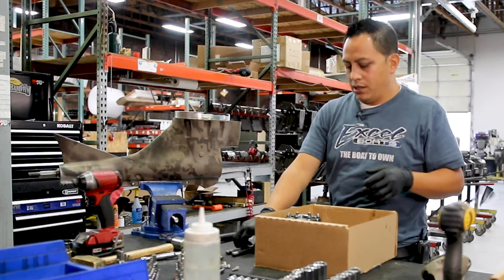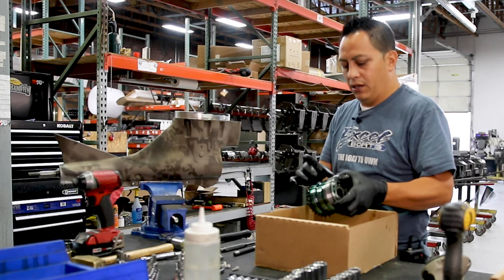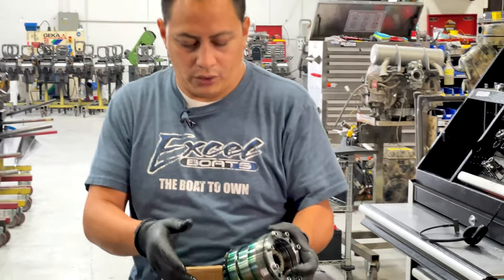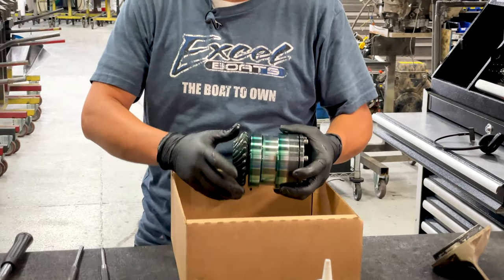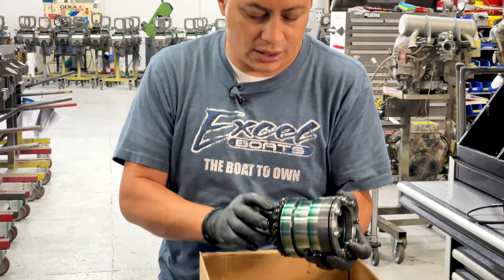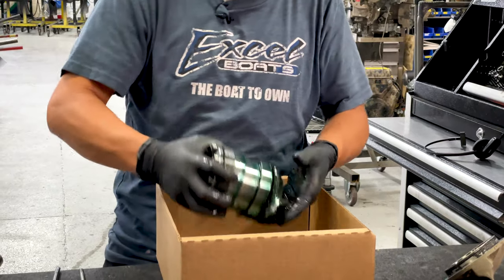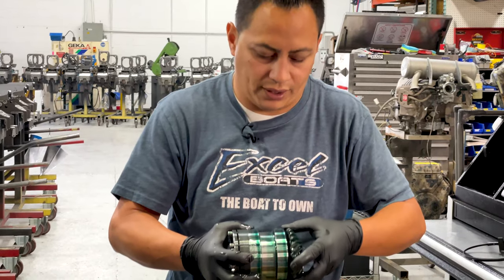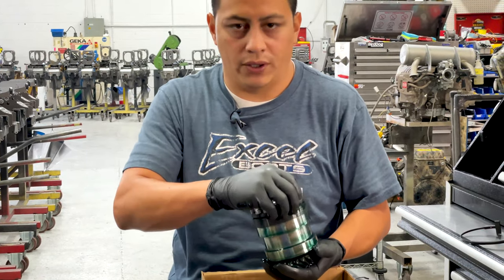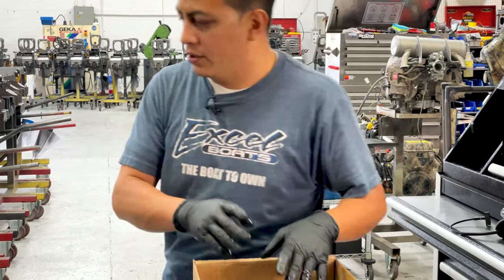On the early Sport V's, this input carrier was made out of stainless steel. The latest ones went with billet aluminum — really really strong and considerably lighter. You want to check the state of these bearings and the gear — you can see the wear on the teeth right here. Everything looks pretty good, no abnormalities. You don't want to feel any crunchiness in the bearings. If you change your oil consistently the way you should, this is what you're gonna come out with — very smooth.